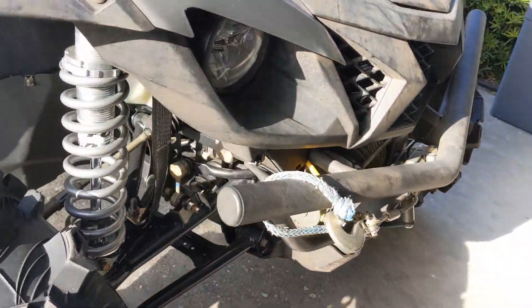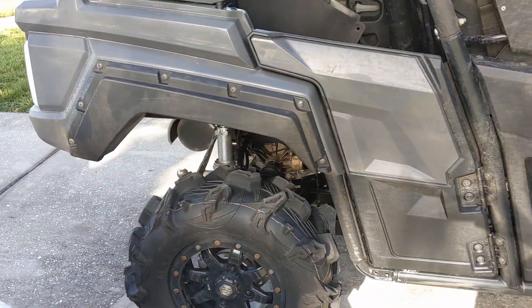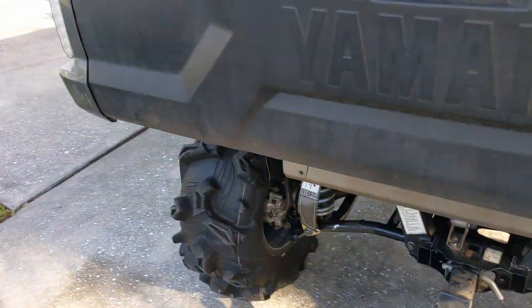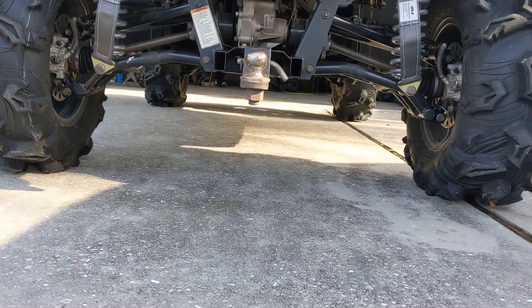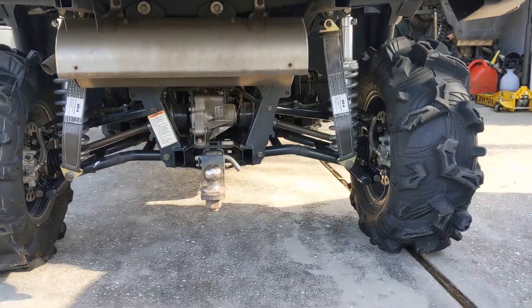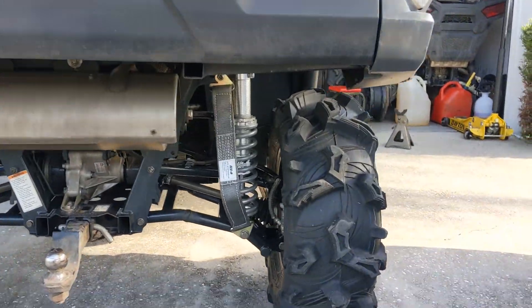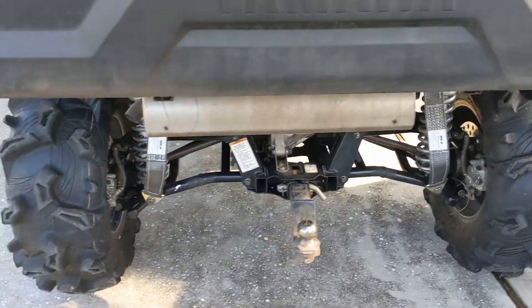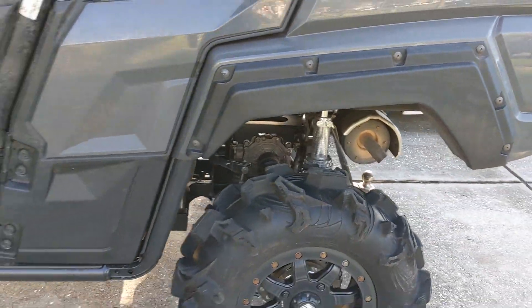The 814 suspension is fully installed on the Wolverine. It only took about six or seven hours because they didn't fit quite perfect and I had to change some things. It did get me some more rear clearance the way they're adjusted now. It still fits in the garage, and obviously the hitch won't be there for off-roading. Improved clearance with a good amount of up and down travel the way I have it set up. If you set the limiting straps up the way the instructions tell you, you're losing a lot of travel — so I didn't do that.